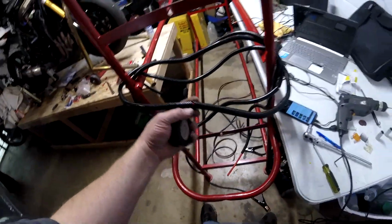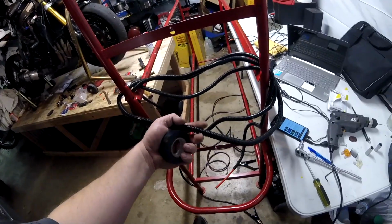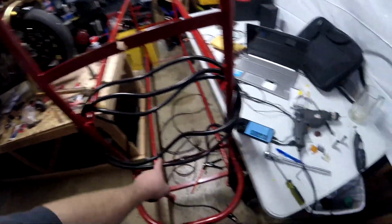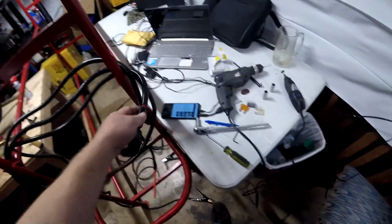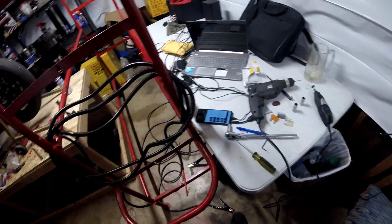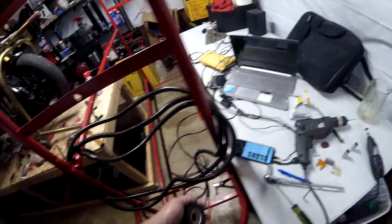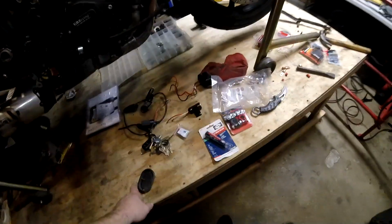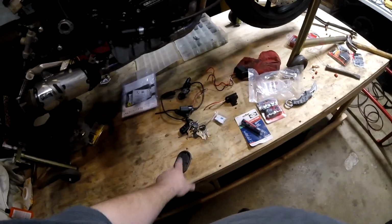I'm going to wrap these ends where they join. Not so much that I'm worried that's going to be the one spot in life where it's going to rub something. It's more so that when I'm pulling the cable and handling it and pulling it up over frame rails and around the truck, these things stay where they need to be. So I'm going to tape these two joints together because I got three 6-foot pieces there for 18 feet total. Then I'm going to loom some negative cable into one end of it for the house battery to ground, and then get that through this piece and back in the truck.